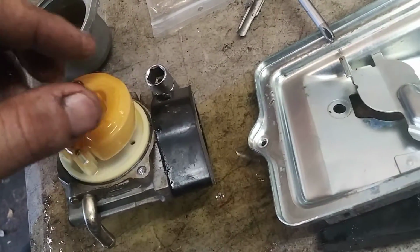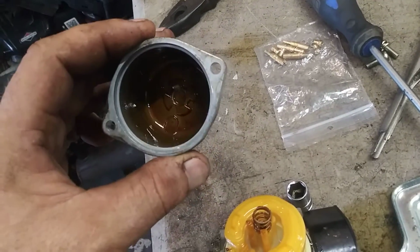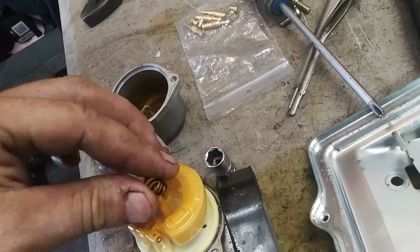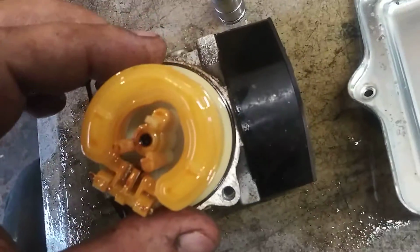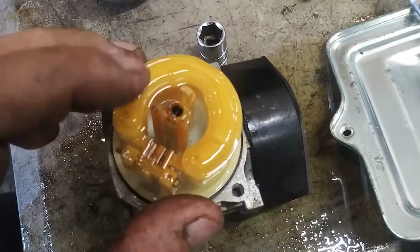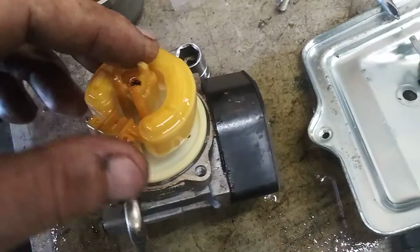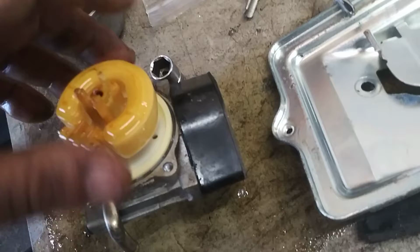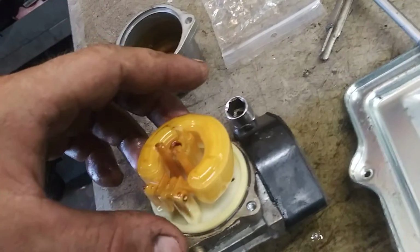and spring. You see this has got like a thin layer of stuff on it. Spring that needs to be cleaned. That jet is completely clogged, and that's the main part, is that jet right there. That's got to be cleaned. We're going to pull this straight off of here. Alright, let me use both hands. See, this is stiff and all needs to be cleaned.